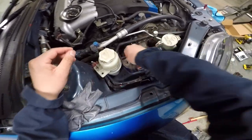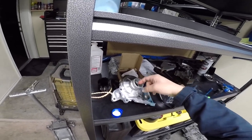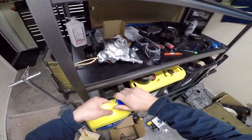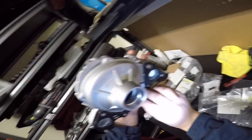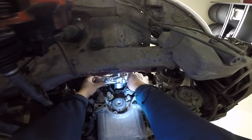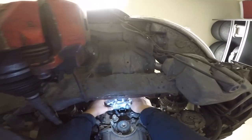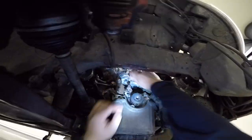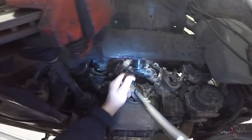It's a good idea to lubricate your rubber o-ring because it could get damaged when installing, but don't use grease because it would affect the seal — using coolant instead works perfectly fine. The way I install the water pump is that I put the bolts on it, then the gasket, and they kind of hold each other in place. Then I carefully insert the whole assembly, thread in all the bolts, make sure everything is aligned correctly, and then torque to spec.